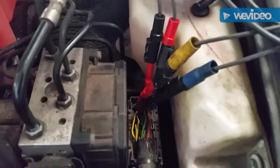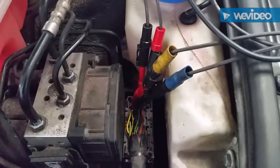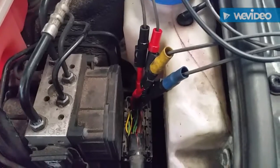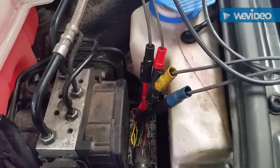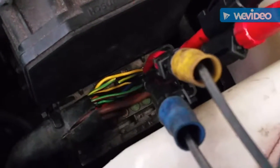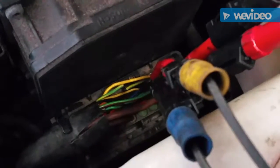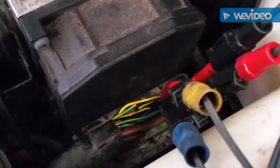Just using the second channel as a reference. You get 0.2 of a volt when the sensor's plugged in, because obviously the ground pulls the bias voltage down, and with the sensor unplugged you get about 4 volts. Just cut the wire, so I'm only measuring what's coming out of the pump itself, or out of the ABS unit itself. And as I apply the foot brake, the bias voltage on that wire drops — time for a new pump. Hope this helps.